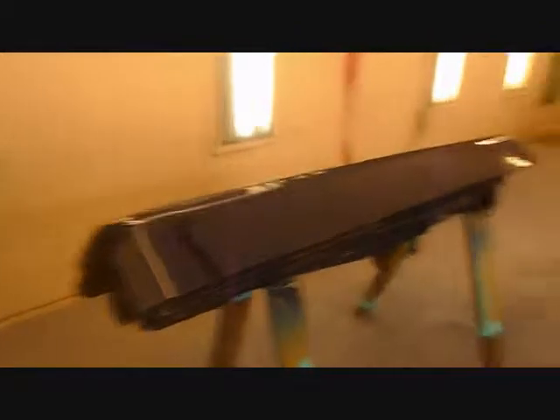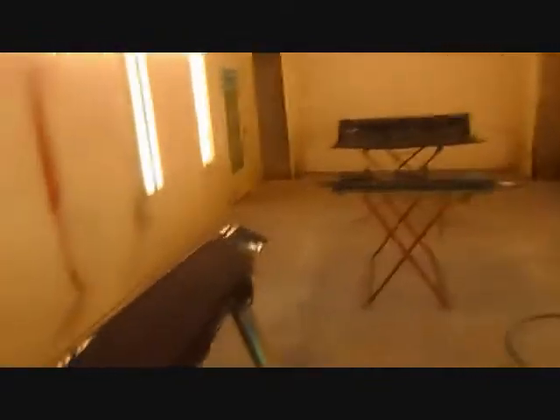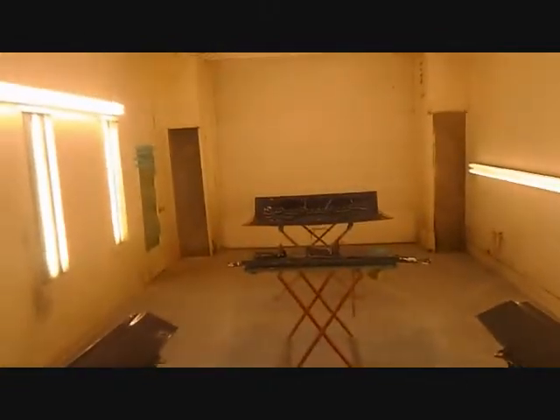There won't be any orange peel or anything — that's what we have our 1500 grit and 2000 grit sandpaper for, to get rid of any dust and thick paint. All things considered, I'm happy with it. First stage, pretty straight, a little wavy, very subtle — won't even show once it's all buffed together. I'll be here working tomorrow. This is Sunday. Bob, out.